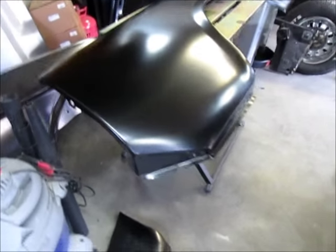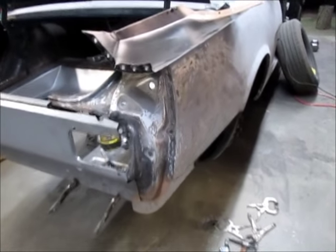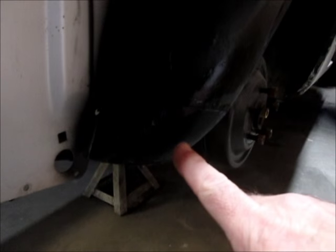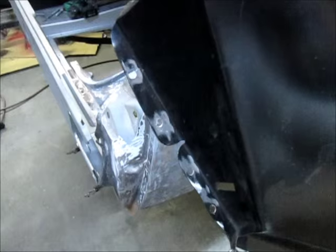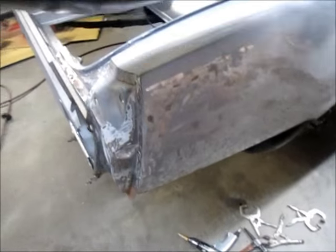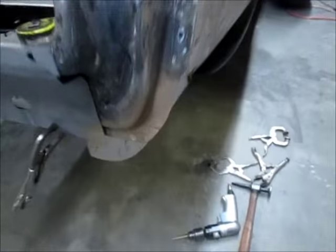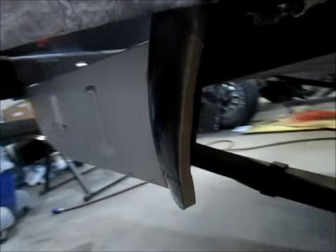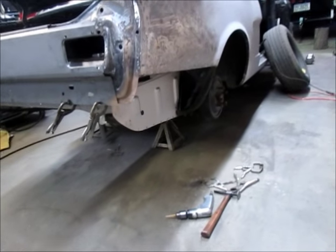I know I'm a bit picky, but that's how you make a quality restoration. I'm making some more progress - I have my little patch loaded in on the bottom of the wheelhouse. I've done the mock work, that's what I'm going to do for my new and improved quarter panel patch. I've got it prepped with welding primer, and on the contact areas that are going to get welded. Hopefully I can get this welded on tonight - my wife's making supper and I'm getting hungry.